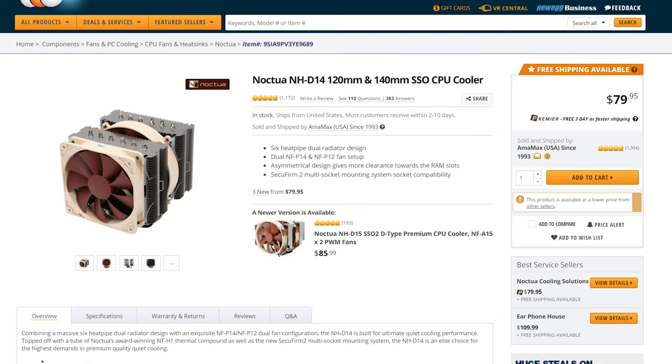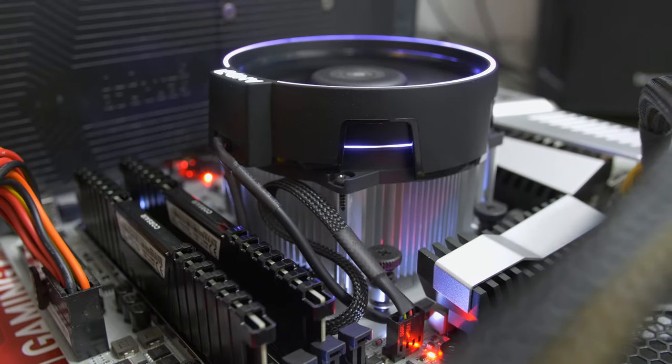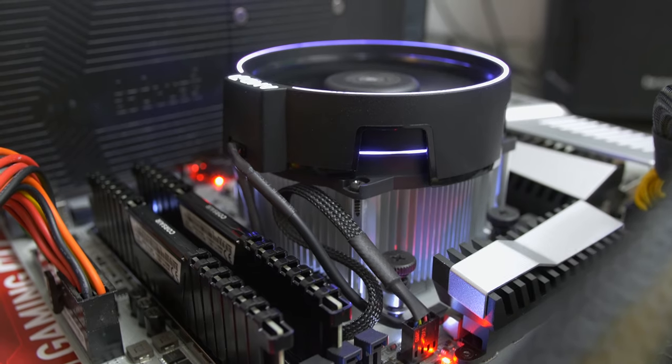So that leads me into how I feel about the Spire overall: if you aren't trying to hit the utmost highest overclock with your R7 1700, then the Spire is a perfectly sound solution that is incredibly quiet and actually offers really decent thermals — especially given it's a 65-watt TDP chip with a 95-watt TDP cooler, so you do have that additional headroom. If you want to overclock, you just might not be able to squeeze every last ounce of performance out of your CPU as you might with a higher-end aftermarket air cooler like a tower cooler or a liquid-cooled option. But overall, a very solid value add from AMD that I think is going to save a lot of users a nice chunk of change on an aftermarket cooler. One last thing: the Spire is a downward-firing cooler, so you're exhausting hot air in multiple directions inside your case, but as long as you have proper airflow with intake fans and exhausts at the top and rear, that should redirect the exhausted air out the appropriate exits of your chassis.